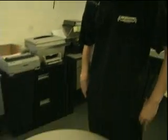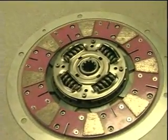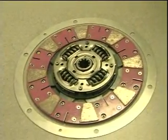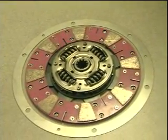This week I'll be talking a little bit about the Roush P51 clutch disc. We found it's a very viable upgrade for any of the high horsepower stick cars. It's a 10 spline direct drop-in for the T-3650 trans that appears in the '05 and up Mustang stick cars. If you're having a problem keeping a clutch in the car, this might be just the thing for you.